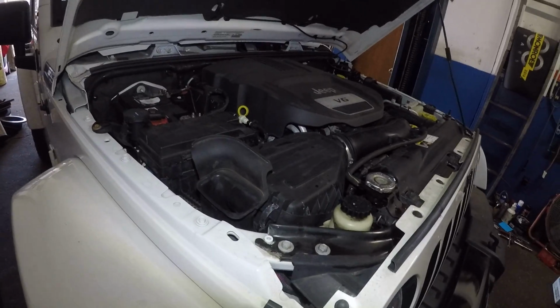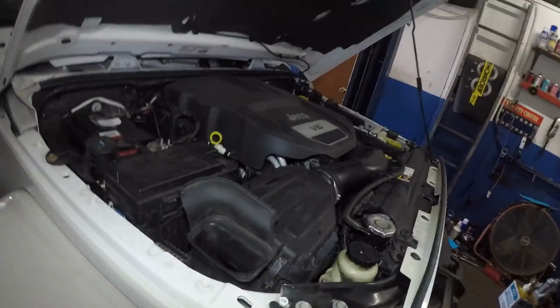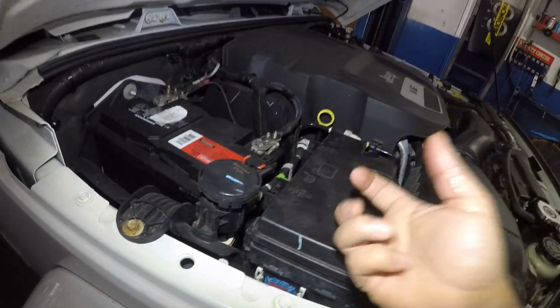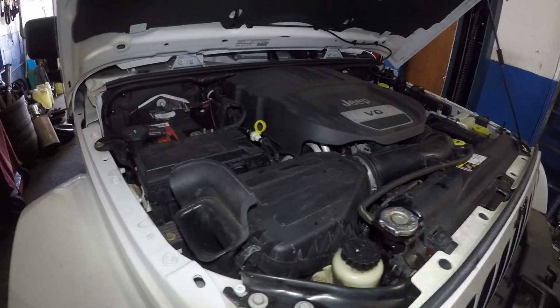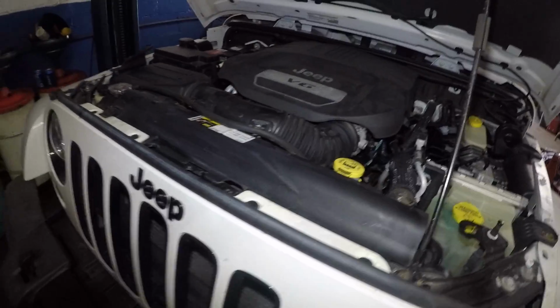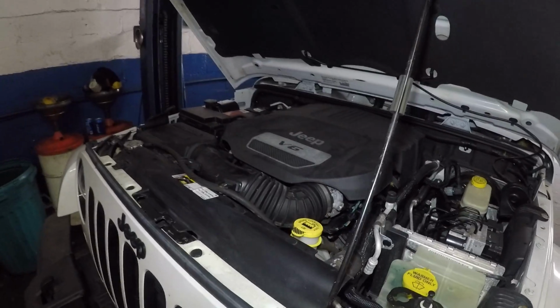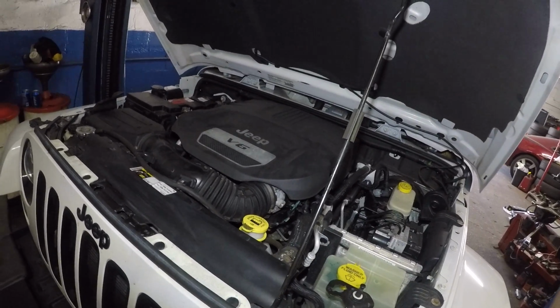All right. And if it's still overheating, pay attention to your fan. Your fan should come on once your temperature reaches halfway. And also, there's relays for the fan, there's modules, and that's going too far. But anyways, I hope this video helps you. Those are just 3-4 checkpoints you want to do if your car or Jeep is overheating. Top off your antifreeze, number one, and check for leaks in any of the cooling system.